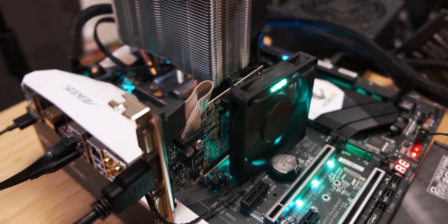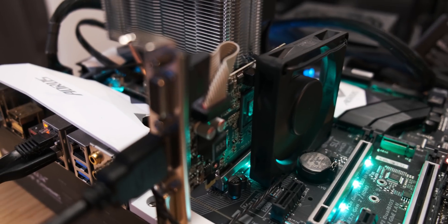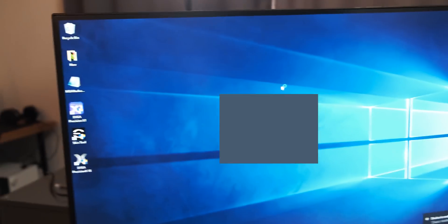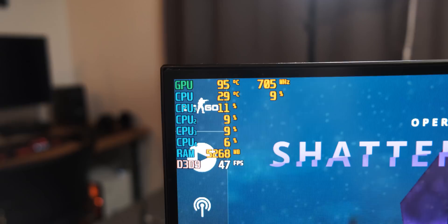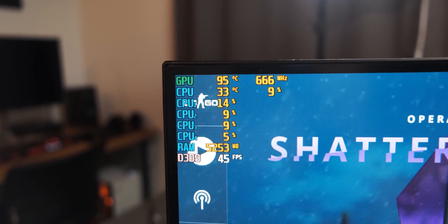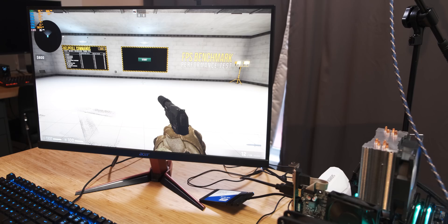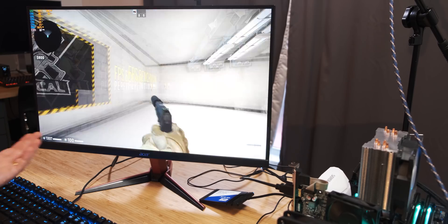We're in Windows! You can actually see the GPU die while we're outputting to Windows. Okay, so it's hit 95°C and now it's starting to throttle quite aggressively. We're at 666 MHz and we're still hitting 95 degrees C. You know, it's still running — that's fairly impressive. This may be exceptionally stupid, but it actually kind of works.